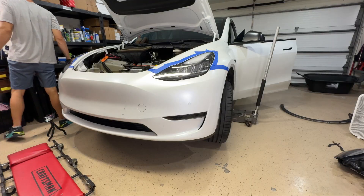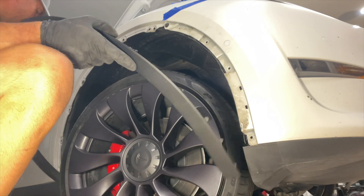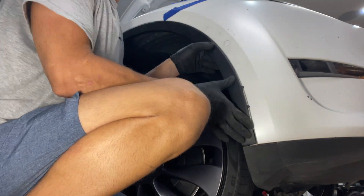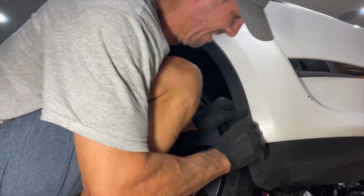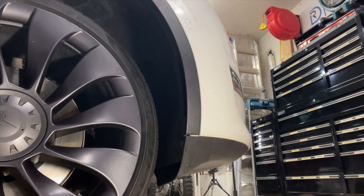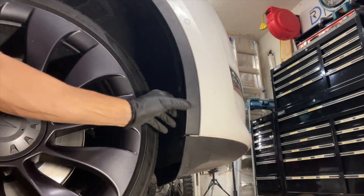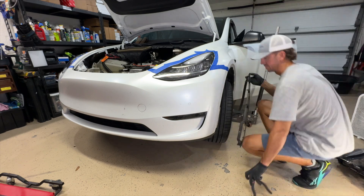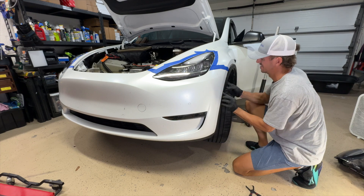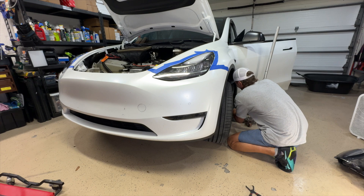I struggled with this for the longest time. So just put that bottom clip in, push it in the middle, and then put the pin in — makes it ten times easier. Now I'm putting the fender well liners on — this is only applicable for the Model Y. I missed those two retainers in the front, got that clipped into place, all good all the way around. There's another pin that goes in this fender well — I had the wrong clip there, there was a bunch of random clips inside this front bumper on this car. So I used the wrong one — this one uses a different style. Now I remove the remaining clips that were stuck in the front bumper and work my way around making sure it clips all in. That bottom piece has to get wedged in on the bottom — you can go from the back forward, it doesn't really matter, you just want to make sure it gets wedged in there on both sides.